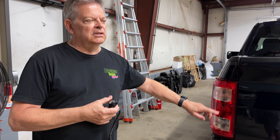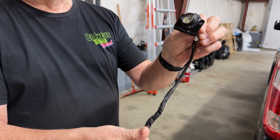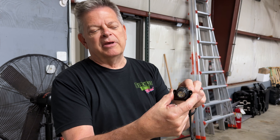Another cool aspect of this build — for those of you who have been doing upfitting for a while, you remember what I call the olden days: if you wanted any lights in the back or the front, you had to get out your hole saw, cut a one-inch hole, and put one of these bird lights in. Every company makes them — Whelen, Phoenix, Code 3, whatever. You'd put them in, hopefully find a place to screw them in, put silicone around the whole thing, and meanwhile all your metal shavings went into the light. We don't do that anymore.